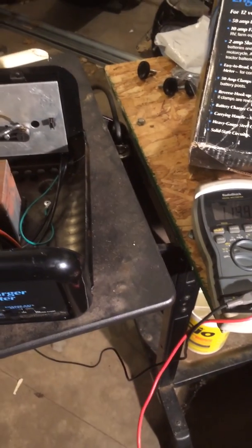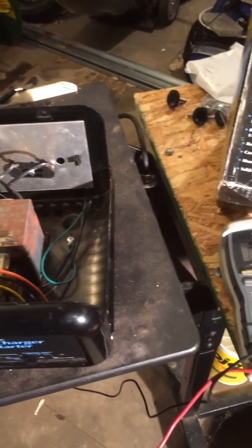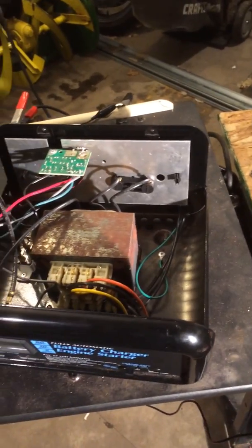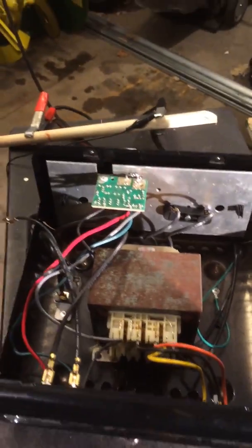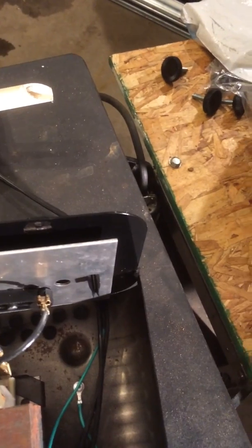When you test your voltage on your 10 amp and your 50 amp, you're not going to get 12 volts. On your 50 amp you'll probably get like 16 volts. On your 10 amp, you'll probably get like 13 to 14 volts. That's normal — it's the way it works when you charge these cars at that many amps. I hope this helps you out on how to get around some of this. These things aren't exactly junk to throw away when they're not working. Just simply unplug that little black wire that goes to that board. As soon as you do that, test your power and find out if suddenly you're getting your 12 volts. I'm going to show you when you plug that in — there you go, plugged in. Retesting right there: 9.3. That little thing is causing some sort of issue.